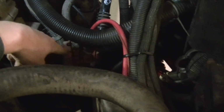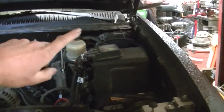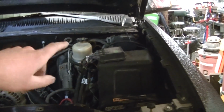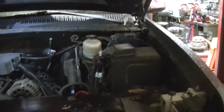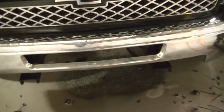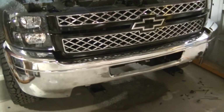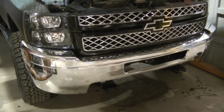But you know, all my wiring's hooked up here. Positive is going down to this terminal right there. Negative's going to the battery like I always do on these trucks. I've got my controller running to the cab. Got a switched 12-volt power source under the dash, so it's ready to go. My plugs are right here. I've got them in the bumper there. They're ready. I'm pretty confident with everything. The plow's going to work. Moment of truth though, I've got to go hook it up.